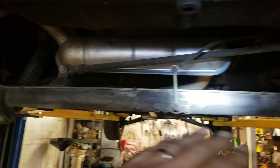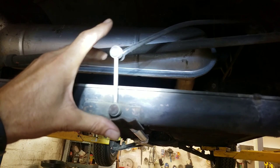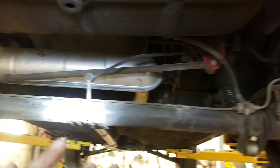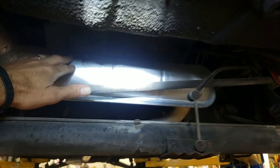Looking at the underside of our 1971 Lancia Fulvia, which has four-wheel disc brakes and is front-wheel drive. In the back it has just a normal beam axle with leaf springs, nothing really special. It does have some type of brake proportioning valve — when the front of the car nosedives and the rear lifts, it adjusts the brake proportioning via a series of rods that go forward to this valve. It has dual-piston rear brake calipers and a nice big sway bar. It has a new exhaust system, a panhard rod to center the axle, and shocks that mount forward. It looks like it has a big muffler and a resonator near the tailpipe.